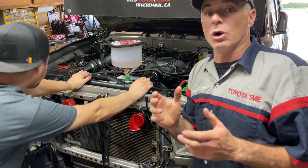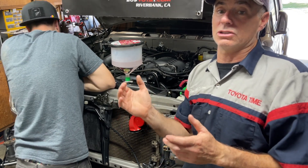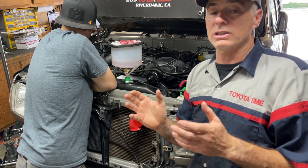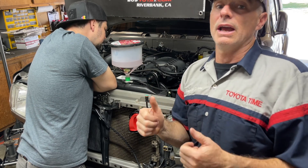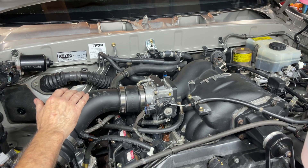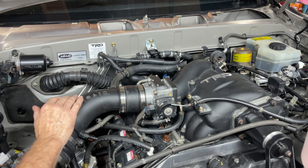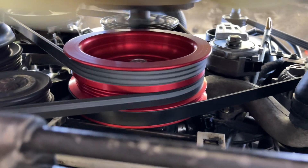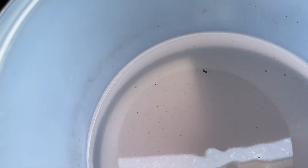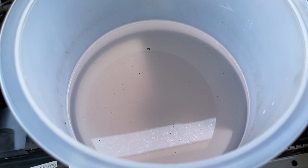After you get it started, you'll want to do a quick look underneath the vehicle, on the sides of the vehicle, everywhere — just check for any obvious leaks, making sure you're not pouring out engine oil or coolant or something of that nature. Once you do a quick search and you don't see any leaks, you're most likely good to go. If you're noticing smoke coming up, that's just some residue, penetrant, and maybe some oil that leaked onto the exhaust manifold — that's going to be normal, it's just going to eventually burn off. There's the URD pulley — so red and so fancy. This is some grit that worked its way out of the cooling system, and this is one of the reasons why we're flushing the system. Some of the junk we cleaned off the block surface made its way into the coolant ports and we want to get most of that junk out.